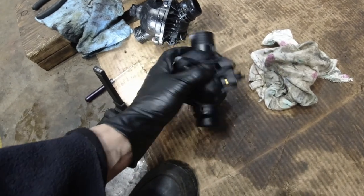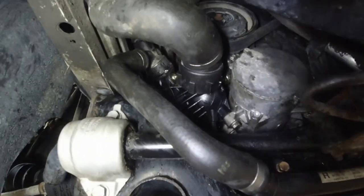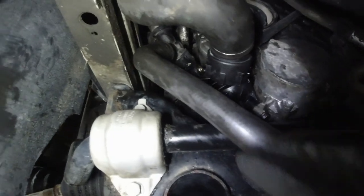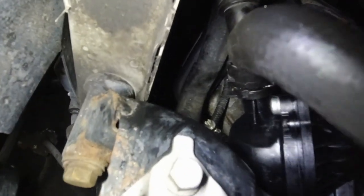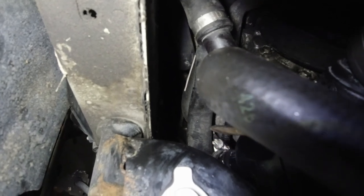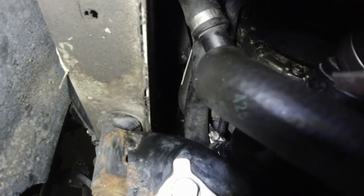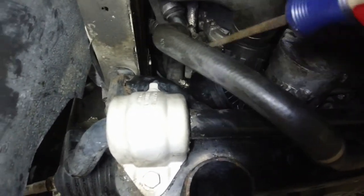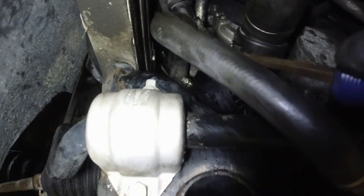Update: the new thermostat is in, exactly as I described — except one thing. Do the clipping hose connection last, because it's going to make it easier to clamp down this first hose here, which you put on before you even put the thermostat in. Clamping it down is quite difficult with the other hose in the way. Then I sprayed brake cleaner in this general area over all these connections and aired it out with compressed air. That way it'll be easy to check for leaks.